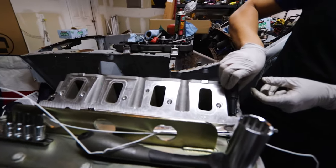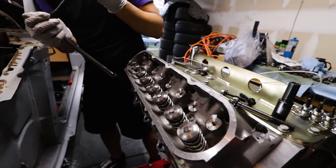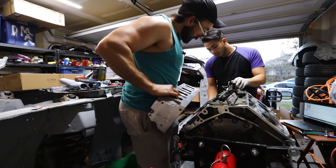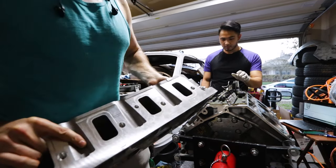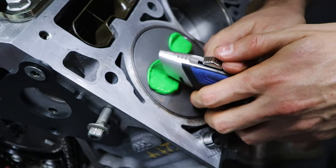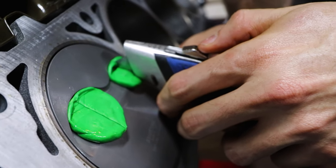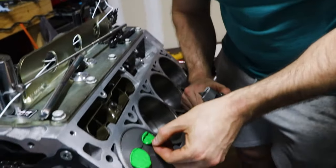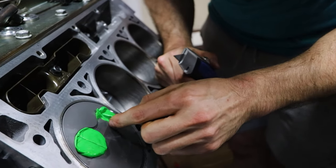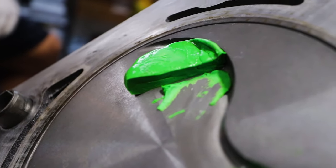We got it all rotated around so now we're going to take the head off and inspect the clay. We've got the rocker arms off and we're just working on getting the head off. The clay didn't come out with it - beautiful. Now we're going to take a cross section, cut it with a razor blade, and take our measurement. We're carefully making a nice little cut, doing the same thing on both sides. We can see the cross section now and see the thickness we have there. We need to measure that to get an idea of just how much clearance we actually have.